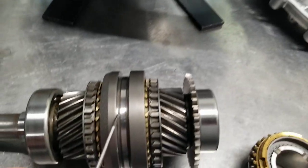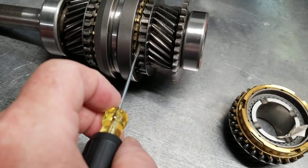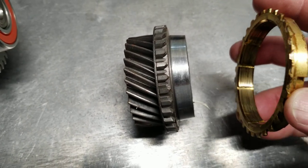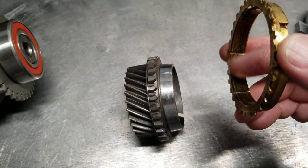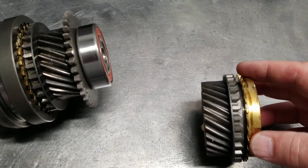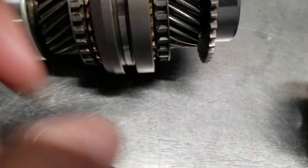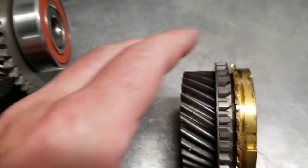The synchro ring was right in here, and this little ring was locked onto the gear. The reason for that is — this is just another one I had in stock — the threads that are cut into the synchro in the back here had worn absolutely flat. It was worn to the point where this portion of the synchro ring almost touches the gear. We always look for 60 thousandths, but this one was making contact with the gear.